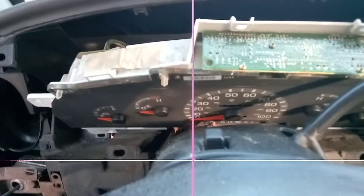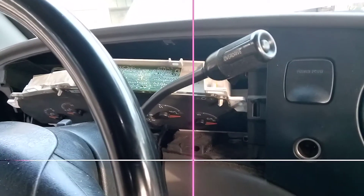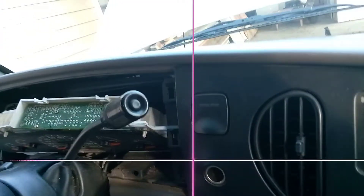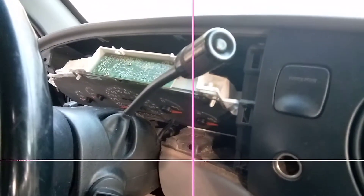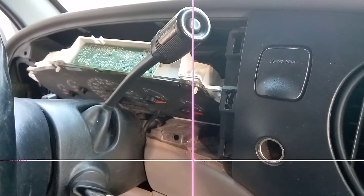I guess it's time to start experiencing electrical problems. So why are we making this video? We got a jump because we had dead batteries. We had dead batteries because we had a problem with the alternator not charging up to par — only charging 13 volts somewhere in that neighborhood — and the voltage regulator would decide to quit when it wanted to.